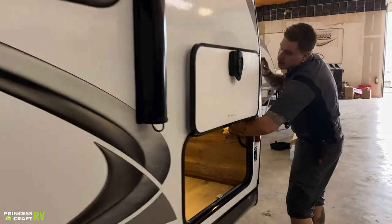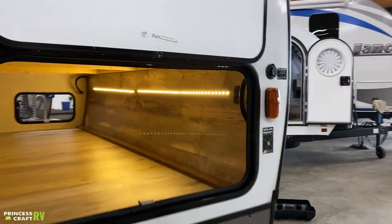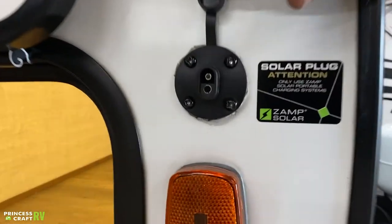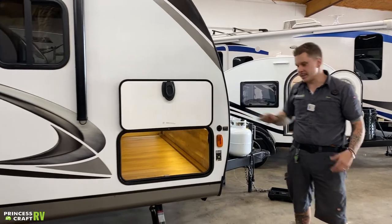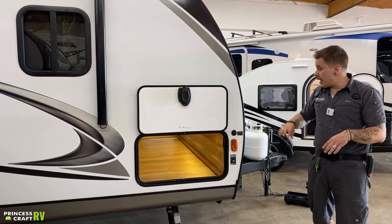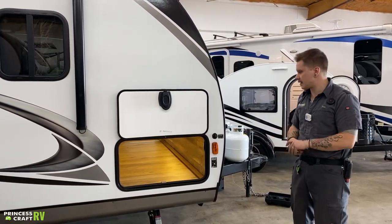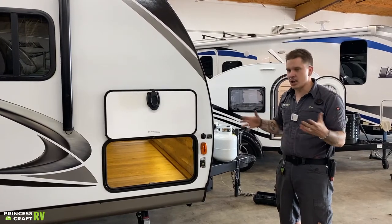In this storage compartment we have a light switch for the LED lights to light the compartment. It is a very large and open storage area. We do have a solar plug here designed for a portable solar panel — any of those briefcase folding panels. It is essentially a plug-and-play connection. Those portable solar panels have the charge controller built directly into the panel, which means you don't have to park your unit in the sun to take advantage of solar. Plug in here, take your panel out into the sunlight, directionalize it, and you'll intake energy without worrying about overcharging your battery.